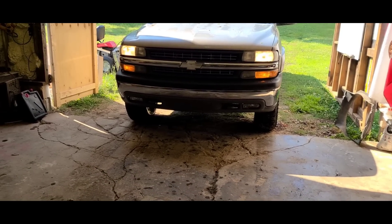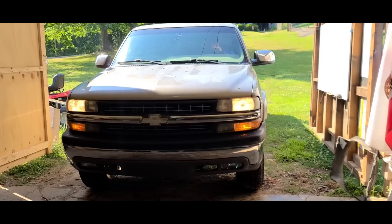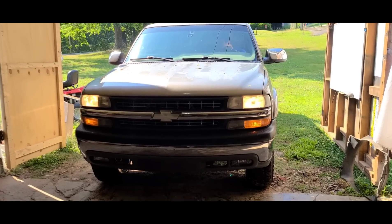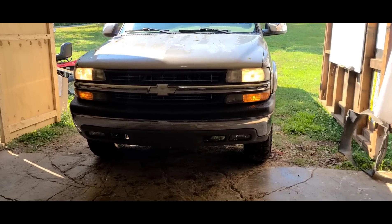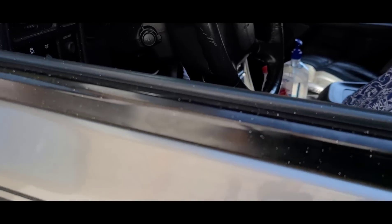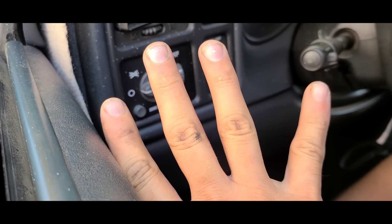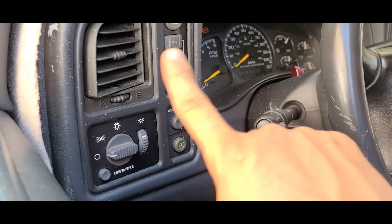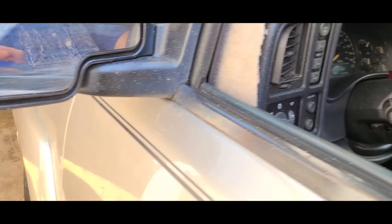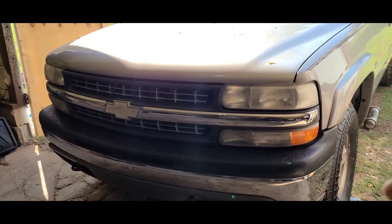The lights should not be on. Now, to turn off these lights when they are automatic — or in some cars they just stay on — like in this case. We don't know how to turn them off, because many owners don't like it since it wears out the headlight covers faster or the bulb burns out frequently because it's working day and night. So quickly, we are going to press a little button called 'dome override.' That button must be pressed four consecutive times. You will hear a sound, and once the sound is present, the lights turn off automatically. Press it Jose — four times in a row: one, two, three, four. There it is — you heard the sound and the lights turned off.